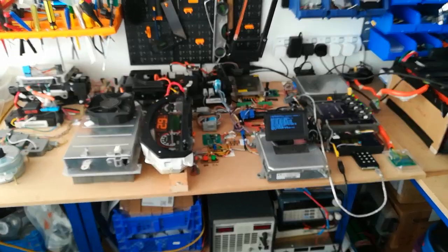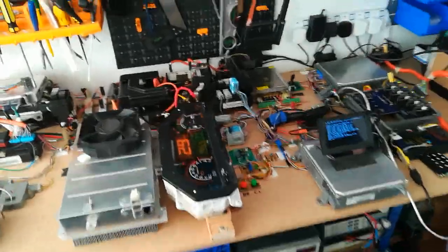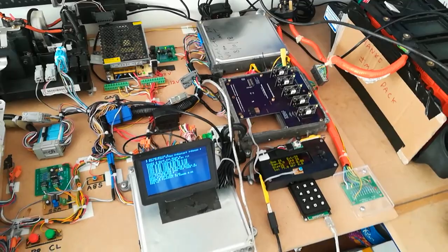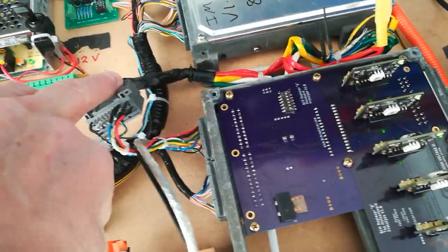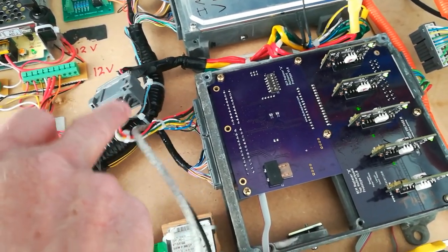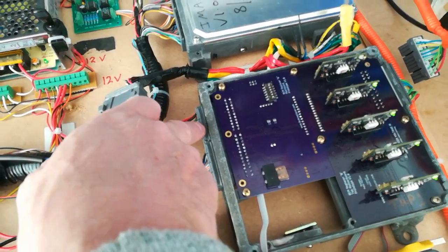Here's the next video in the BCM Replacer video series with the system operating on the bench. Today we've been doing some simple things really to aid installation of the system in the car for further testing. So I've made an adapter here. This takes the input from the sensors from the car, heat sensors, a temperature sensor from the battery pack, and it's got my video connections here, and it just transfers it to another plug.